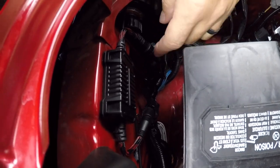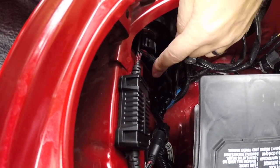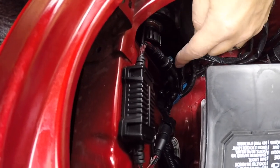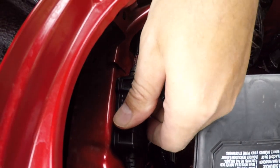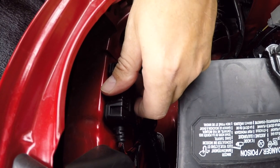So that's the first side. The good thing about doing it this way — if I need to change the bulb down the road, I can just unscrew it right here at the connection, pull the bulb out, put a new one in, tighten it back up, and the driver is still securely fastened. So let's go over and tackle the other side.